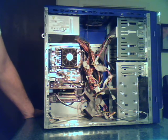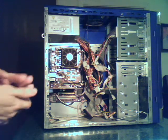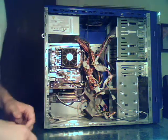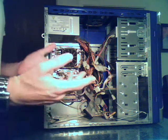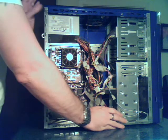There are little testers you can get on eBay for like $4. But anyway, down to business. First, you need to ground yourself before you put your hands in there, because you could destroy your motherboard. Your body can carry a static charge, like when you're walking across the carpet. It also helps to have an anti-static bracelet — you can pick one up at Best Buy for just a few bucks. First, ground yourself, just touch the case.